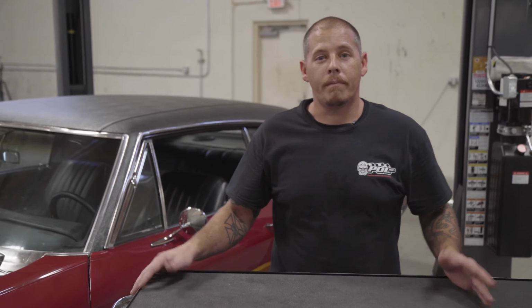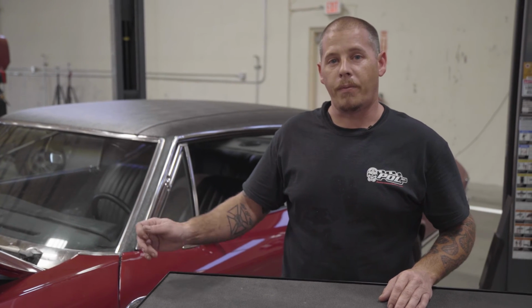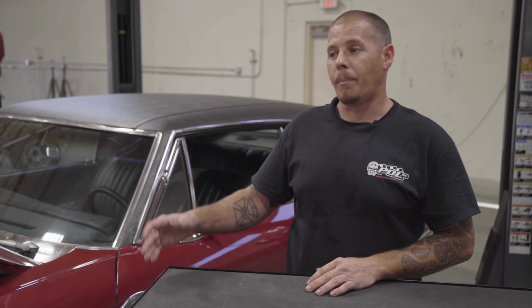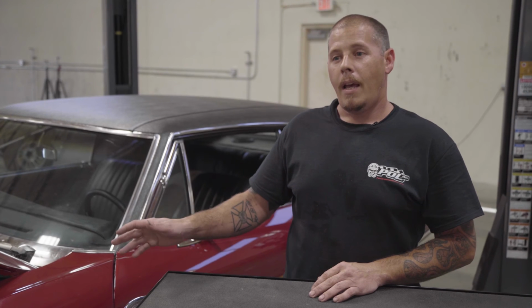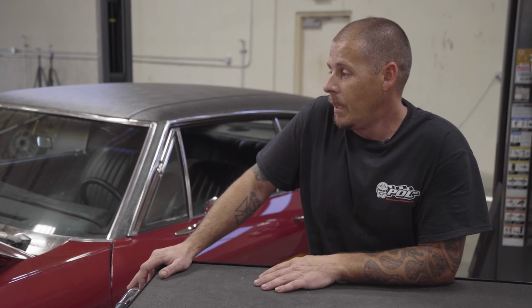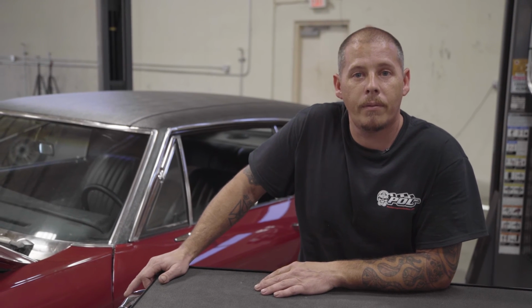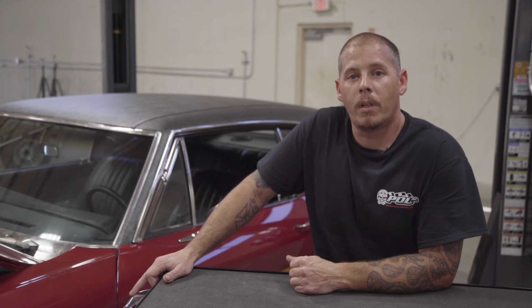All right, you guys, well, that wraps up our install there. The only thing left to do would be to add your coolant to it. Double check and make sure, fire the car up, get it to operating temperature, make sure your fans kick on and that everything's working properly before you take it for a night out on the town. So I really hope this helps you guys with the installation of yours, and that it solves any overheating problems that you might have. But thanks for watching.